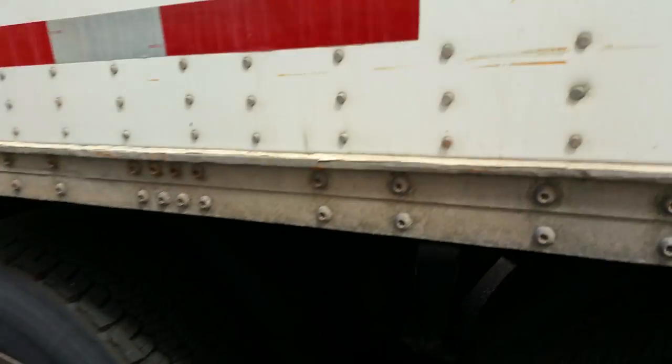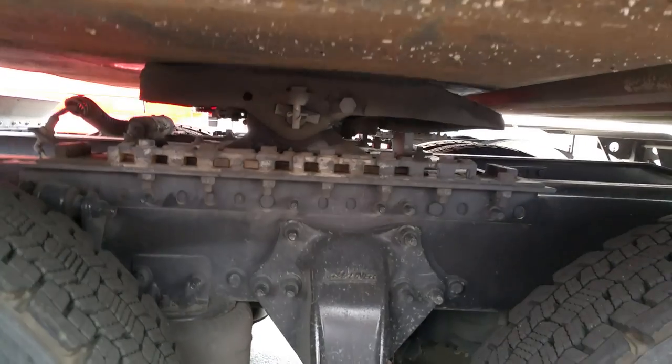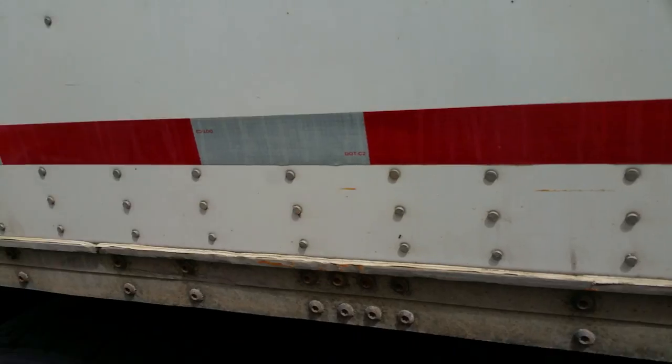How often would you have to adjust the fifth wheel? I've been with the company three months and I've done it maybe three or four times, picking up heavy meat loads. That's how you slide your fifth wheel to take the weight off the steers. Once you get the weight off, you'll need to go re-weigh. The first weigh is ten dollars and fifty cents — the company will reimburse you. The re-weigh is two dollars, and make sure you keep the little number ticket from the bottom of your weight scale.